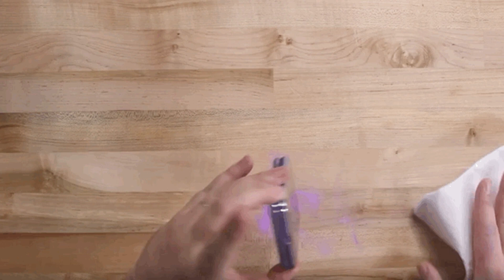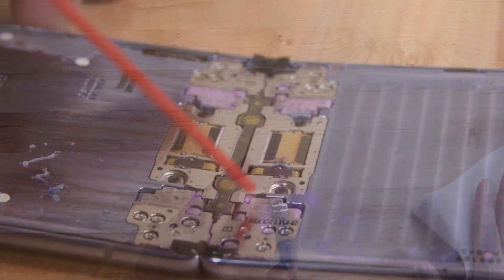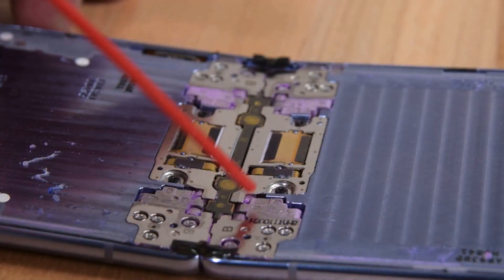Here's what that hinge looks like on the inside — you can clearly see a lot of the purple dust caught in it. Here's the hinge completely removed from the phone and covered in purple dust. You can also see the fiber shields outlined by iFixit's white rectangles. Interestingly, they look quite clean, possibly suggesting that they don't actually trap that much dust.